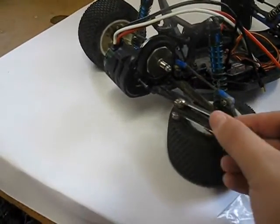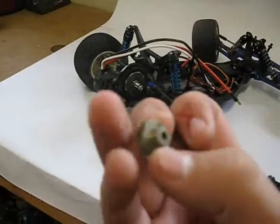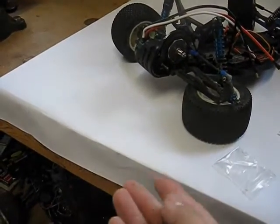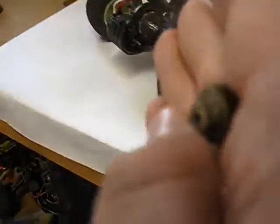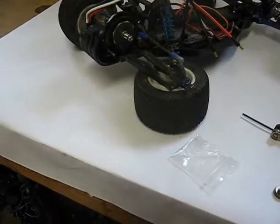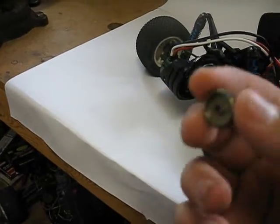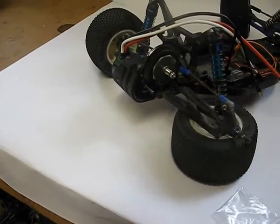After taking the wheel off, I've started to screw in the motor just to get it mounted. That feels good. Now that it's mounted, I'm going to go ahead and install my Losi 27 tooth pinion. I know it's Losi on Associated once again, but it's a really great pinion — they're finished very well. They're tapered on the edges. You can see how it's tapered instead of flat like some others. I have one sitting right here for demonstration — see how this one is flat? On the Losi pinion, you can see it's tapered off on the sides of each tooth. Very nice pinion; it makes your car significantly quieter.